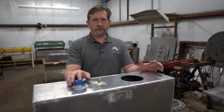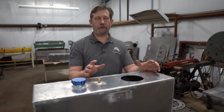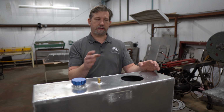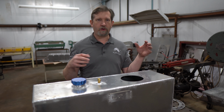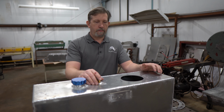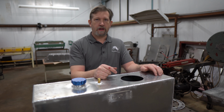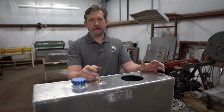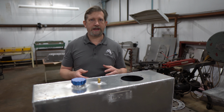And we do that because it's such a pain to install one of those fuel pumps with the clamping ring and try to hold it all together while you have this gasket crap all over the place. So what we decided to do is add the riv nuts in there, but we took it a step further and decided to add 2 additional riv nuts in ours.